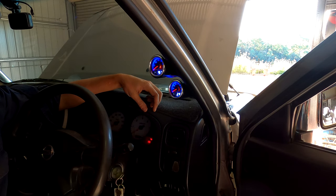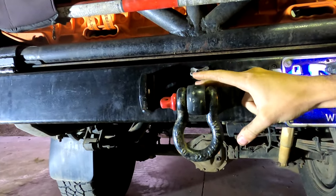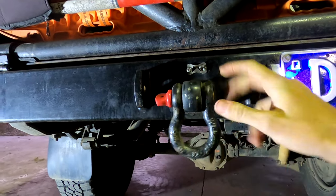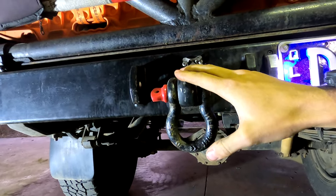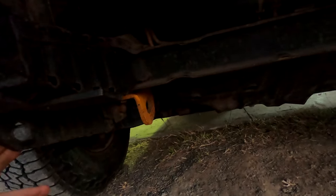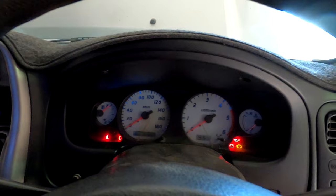Another thing worth looking into is recovery hitches - these go into your tow hitch and let you attach a D-shackle, which is a lot safer than pulling off a tow ball. And for the front, I've got Road Safe recovery points up here and here. They give you front recovery points as opposed to the factory tie-down points - I don't think those are actually rated recovery points. These bolt into your chassis across two points, share the load, and you can set up a bridle system to make them even better.